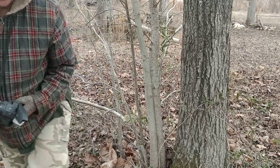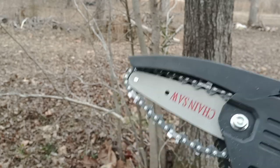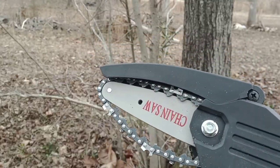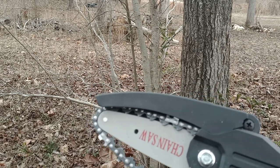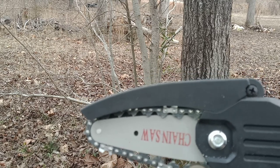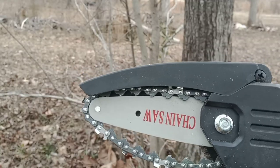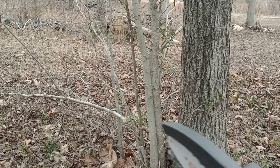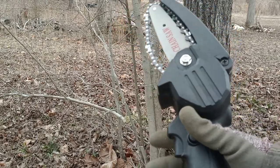Yikes — this is why you tighten your chain beforehand, because if you don't it's gonna come off. It's basically come off the back part here, so I'll just have to undo this and put it back on and then tighten it. I had a conversation with my son about it and he said when you're holding it like this you should only be able to see two or three teeth — and if you can slip more than a dime through it then it's too loose.